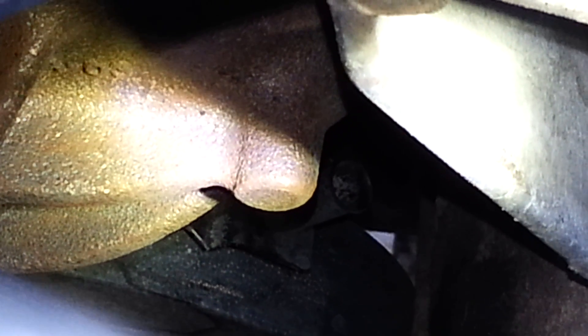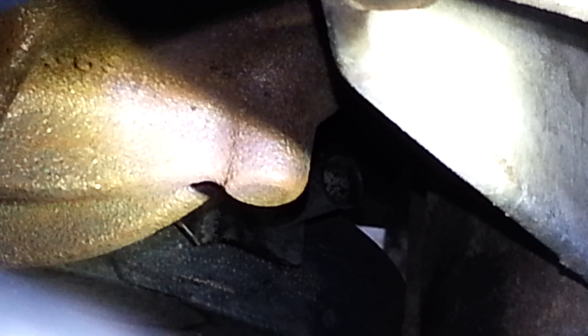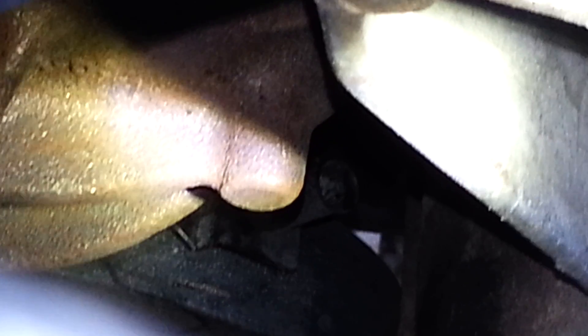If you can't see it on yours, clean it to where you can see where the zero is. It'll be the deepest fork-looking groove cut into that plate down there. The little black plate to the left is the deepest groove — that's where the zero is. So you're going to set your timing at zero degrees.